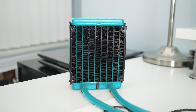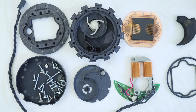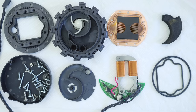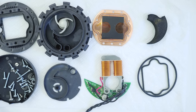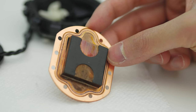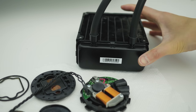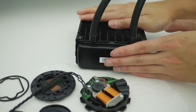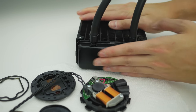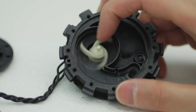So that's a quick breakdown of my CPU liquid cooler. Yours may be a little different depending on the model, but most will operate in the same fashion. The symptoms of a failing CPU liquid cooler are fairly easy to triage. On mine, the pump head was warm or hot to the touch, but the bottom of the radiator was cold, indicating an issue with liquid flow — either a pump failure or a blockage from debris or an air bubble.